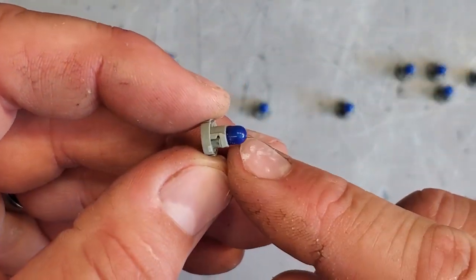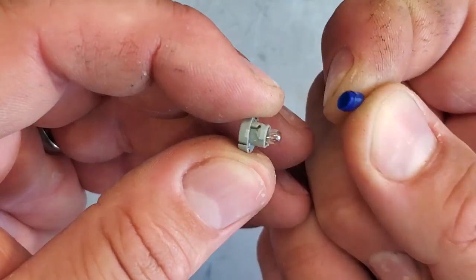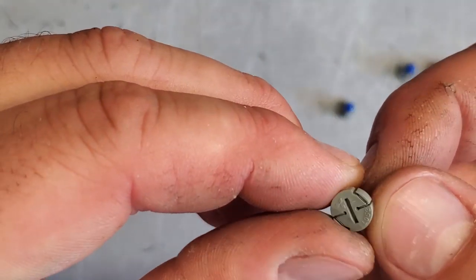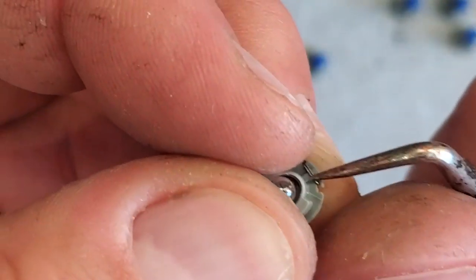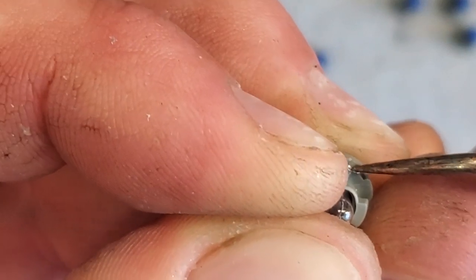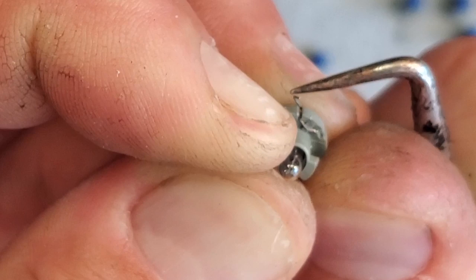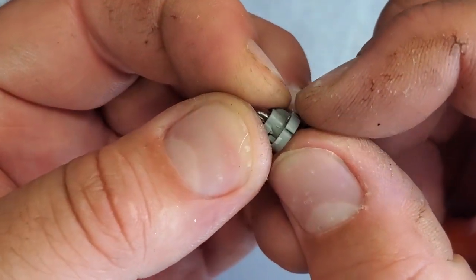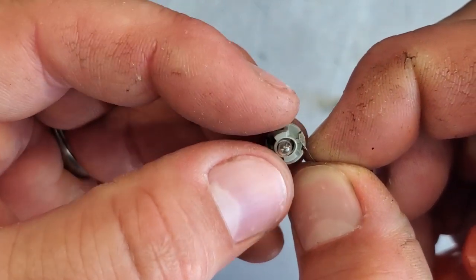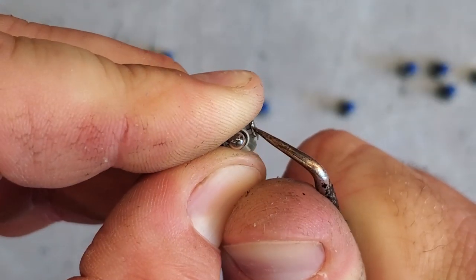We are going to have to reuse this little rubber tip. So we'll slide these off and we're gonna have to open up these little sockets and take the bulbs out. So I'm gonna use a little right angle pick. I'm just gonna flick the little wire off this perch here. There we go. And when it's off, you can just bend it around, follow the path. There we go. We got one lead out. Do the same thing for this side.